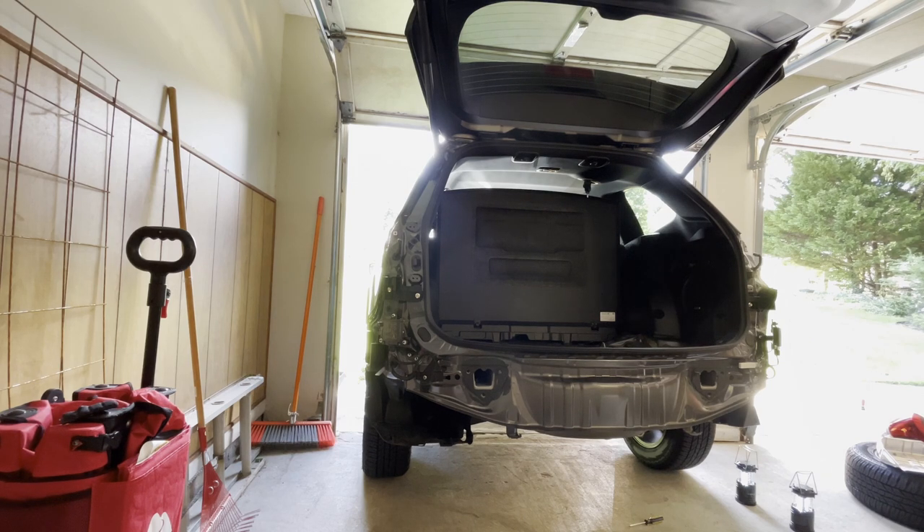I got the muffler and the heat shield off. The muffler was a little tricky - those rubber hangers were actually the hard part. I had to get some gloves and work them off. The actual exhaust connection for the muffler was 14 millimeter, the same as the bash bar on the back, so I was able to use that same deep socket. The next step is to remove some rubber grommets from inside the side frame where we just removed those components.